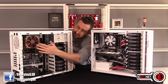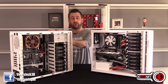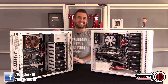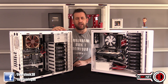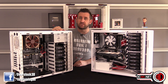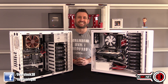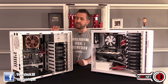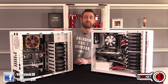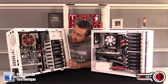It's got a face-down Noctua cooler with no fans throughout as well. It's all housed in a stock Fractal R3. It's got an Adaptec 51245 RAID card, which is 16-port — 4 external, 12 internal. I had that hooked up to six Western Digital Green 2TB drives in a RAID 6, which ended up giving me a usable amount of data at just over 7.6 terabytes. The power supply was — and still is — a Silver Power 460-watt passive unit.